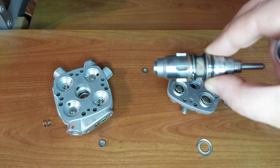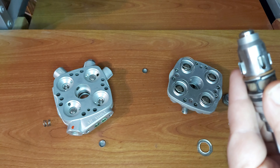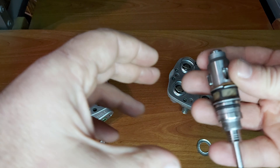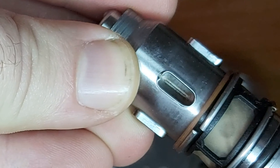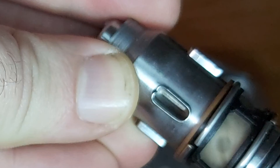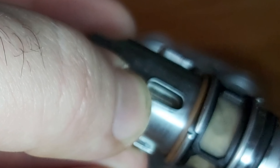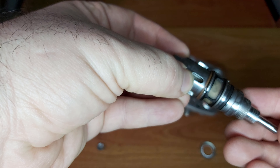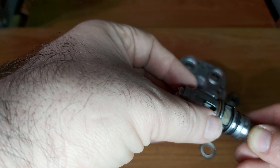So why is our plunger so important? Let me show you. If you see this slit here — look now — if you pay attention: the more the plunger goes in, the more it closes these slits. So once the car is off, this plunger is in its zero position and no fuel can flow from the lower chamber to the upper one.